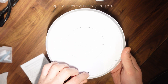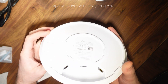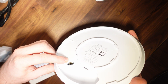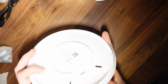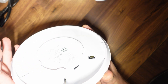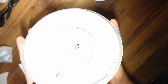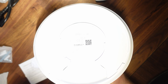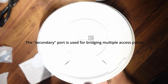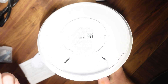Popping this top piece up, just inside there we have a USB port — not entirely sure what that's used for. We've got a secondary RJ45 connector, with a label saying 'secondary', and we've also got the primary, labeled 'main' just down here. I'm assuming when I plug the CAT6 cable in to power and provide data to this device, it'll go into the main port. I'll give an update shortly on what the secondary one is used for — possibly a pass-through, or maybe you can feed two RJ45 cables in for redundancy, connecting to two separate switches.